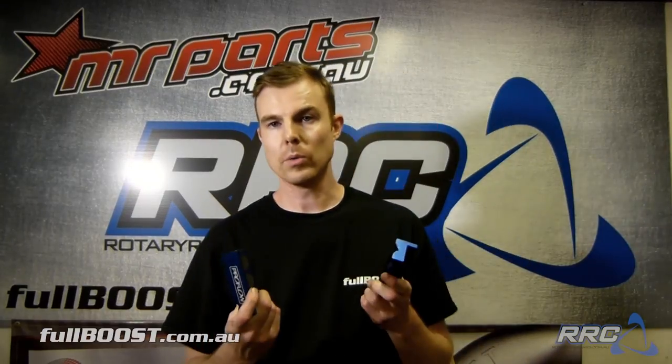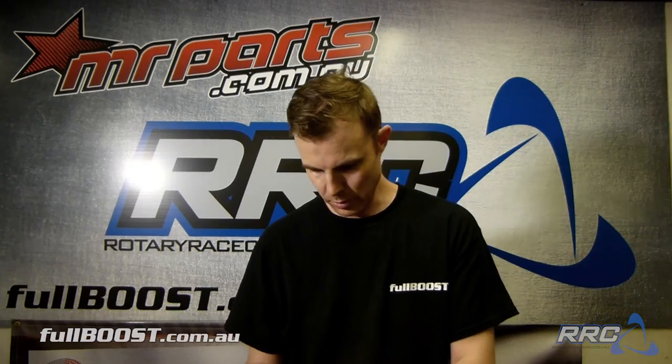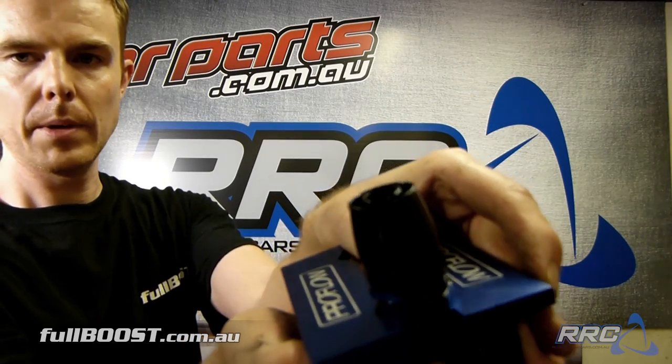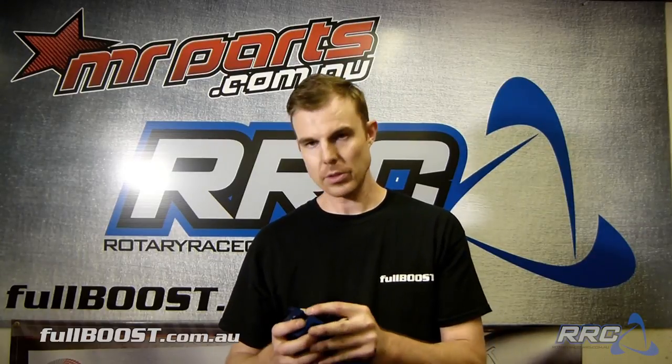You need something to hold the fittings together when you are assembling them. So you're obviously more than likely going to use a vise. These are soft aluminium vise jaws. You'll see that they're cut out perfectly to fit the fitting. So they're cut in a hex way. So when you do put them in a vise and clamp them together, this will just hold it basically like so. And it means that, again, it'll hold the fitting exactly where it needs to be held. It won't mark the fitting again, which is another bonus.